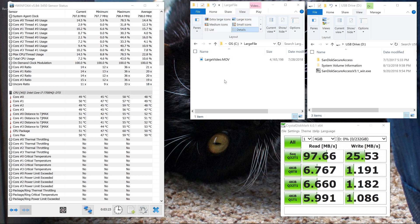I want to do that test one more time, but this time I'm going to keep an eye on the core temperatures. I don't believe there's any throttling going on here - I actually think there's some caching on the USB drive, and when we do a sequential copy of a large file, we're hitting the limit on that. The performance bottleneck based on the size of that file and its use of the cache is causing the performance hit to creep up and become visible.